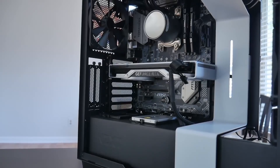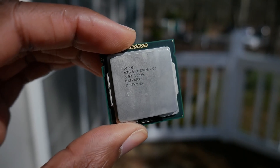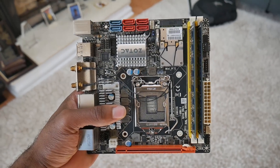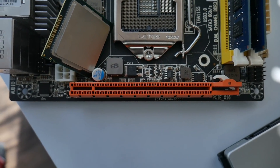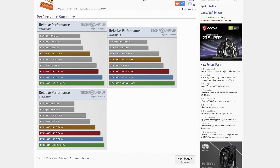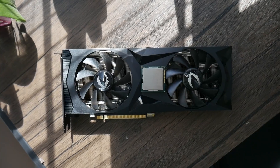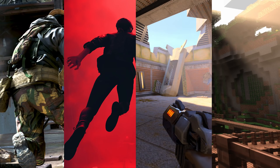To keep things a little more scientific, I'll have another test system available so you can see performance without such a major bottleneck. Something worth mentioning is the bandwidth limitation of this processor. My motherboard is the H77-ITX-AE from Zotac and it supports PCIe 3.0 x16, but unfortunately the Celeron only supports PCIe 2.0. This means we're only going to get at maximum around 80% of the available bandwidth on the RTX 2080 Super. Honestly, I'd be surprised if the Celeron could squeeze out more than 50% of the 2080 Super's performance. The games we'll try are Call of Duty Modern Warfare, Control, the Quake RTX demo, and the Minecraft Beta RTX demo NVIDIA just released.